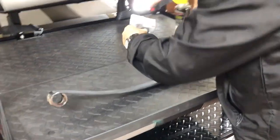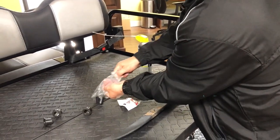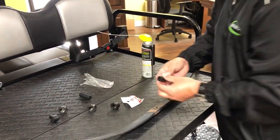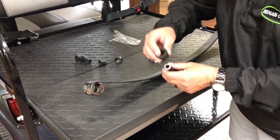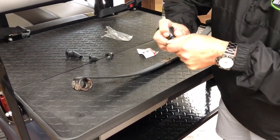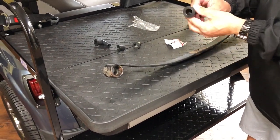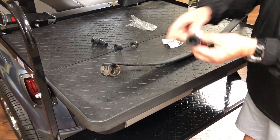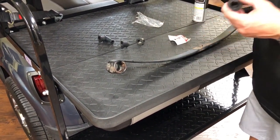Now when we put new bushings in, our friends at Redhawk supply us with bushings. Here's your bushing tube, and here are your larger bushings. It is extremely important to put dielectric grease in here so that when you push in these bushings, they go in much easier.